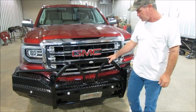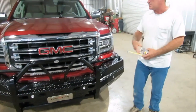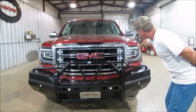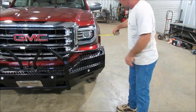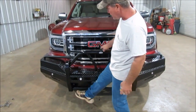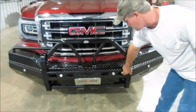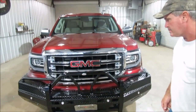This is the 2016 GMC front end we're putting on there. This is an extreme. To align this thing, you'll measure on both sides to make sure it's the same distance from side to side. The regular front end has loops — the full top bar with loops that wrap around the side. Right in the center of the truck, I lined the rear view mirror up right here, and you can step back and line the loop up with your hood line right there. Make sure you get it right up and down. To get it side to side, you can either measure the fore plate, or measure the loops to make sure it's the same from side to side. Once you get that, tighten one side, then get a jack on the other side and lift it up, get back there and make sure it's the same, and then tighten the other side. Remember, on those lower brackets, there are two half by 1-3/4 bolts on each bracket, and then you've got that upper tab — which is actually easier to put on after you've hung the guard on your bottom brackets.